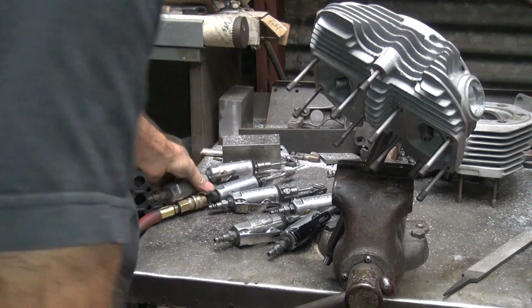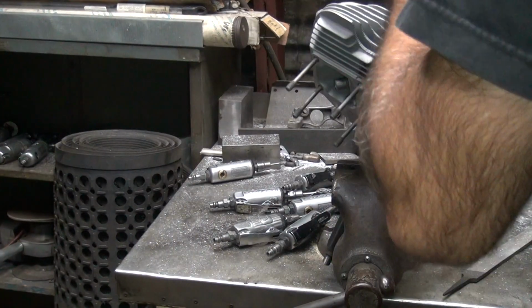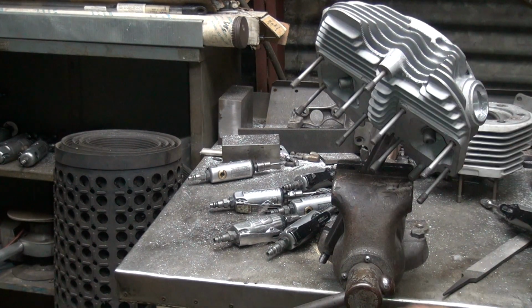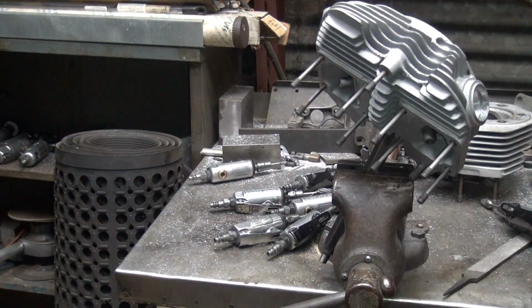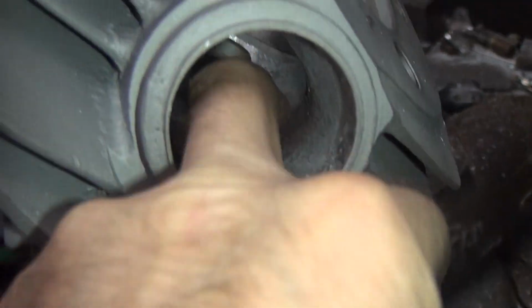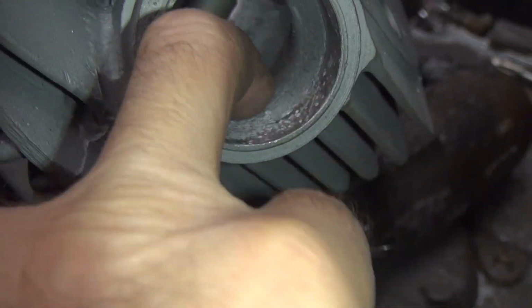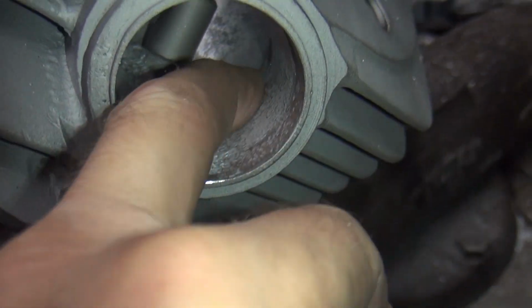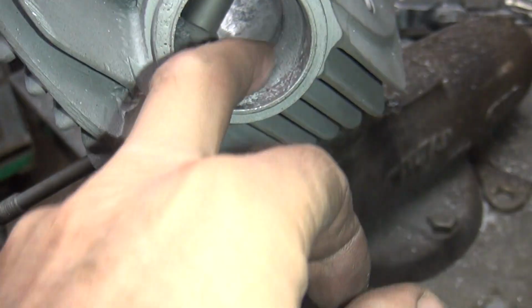Okay. The other side. I've got to work with over here. Okay, so now, see how it's opened up back in here. A little bit of a high spot through here, and then it's nice here. So you can knock this off a little bit right here and blend the two. The bottom's good. Top's good. Just right here in the side wall. That's it. Right where my fingers are going to cut. Blow about a 1/16 out right through here. That's it.